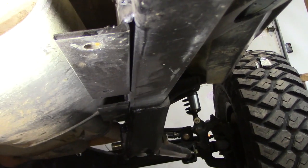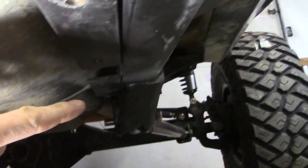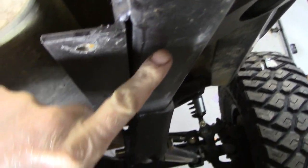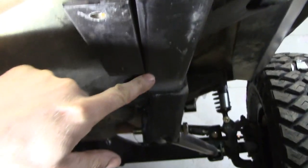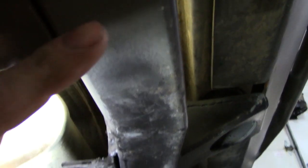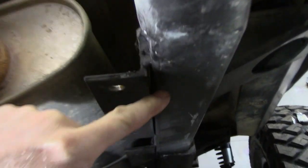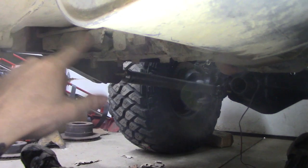The first thing that you'll want to do is remove your skid plate, which I've already done. My skid plate has door hooks on the inside of the frame because I didn't want to run nutserts, but yours will actually have some nutserts all the way along this frame — I want to say four. So you'll want to take those out, but before you do, you're going to want to make sure you support the transmission and transfer case.